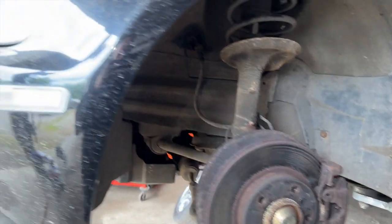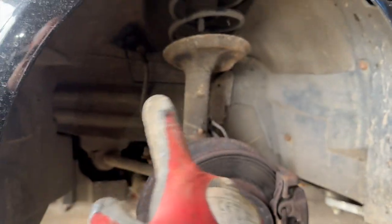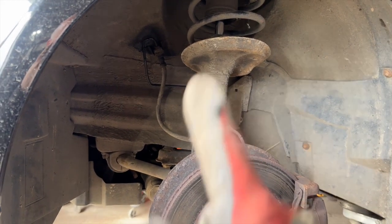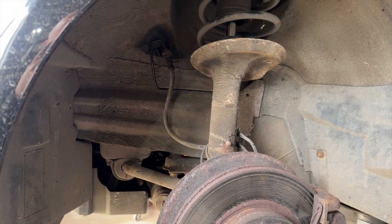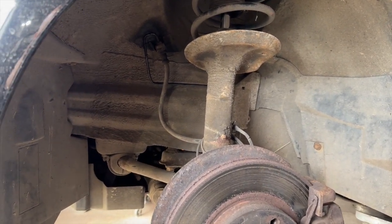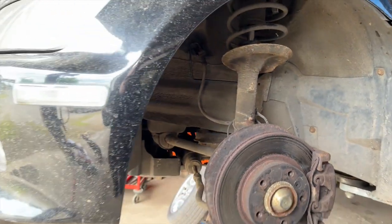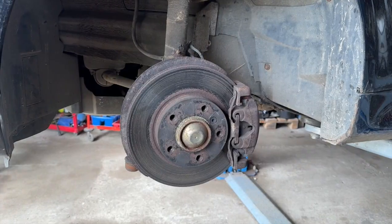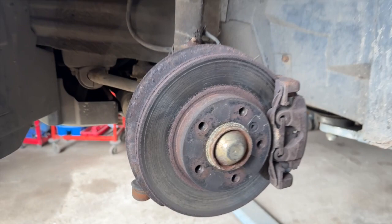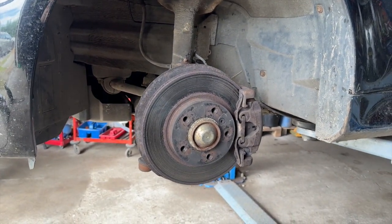It was advised on the MOT of the Z3, which I've now got on the lift, that the front brake lines were flaking or covered in stuff. It was just the outer coating — they're actually completely solid. So I've just rubbed them down a bit and covered them in black paint. They're absolutely fine; there's no corrosion on them at all, so they're good to go again. The brakes do need a good clean up since it's been sat for a long time, so it needs a good drive out and clean up before someone notices them.